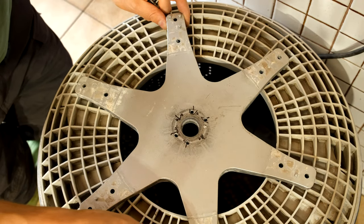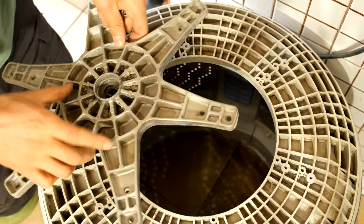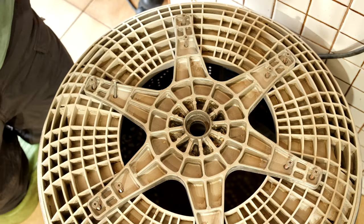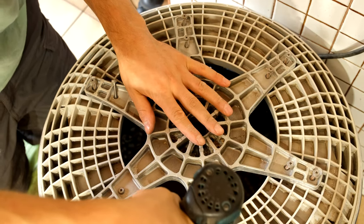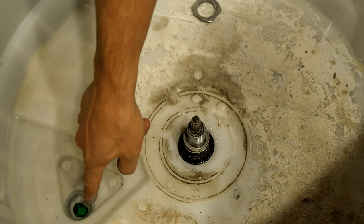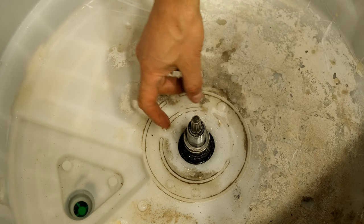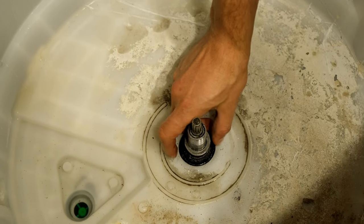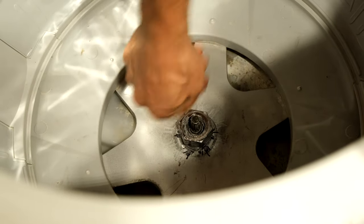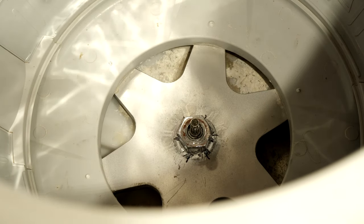To attach the drum to this plate, you'll see there are raised nipples which need to be placed into the drum, so I'm just going to follow the pin-outs. Just check for any debris — you don't want it to block anything. There's an impeller here to suck out the water. I'm just checking that everything is fine. Now it's time to put the drum on. There's that washer — if you wanted to you could put a drop of Loctite on there.